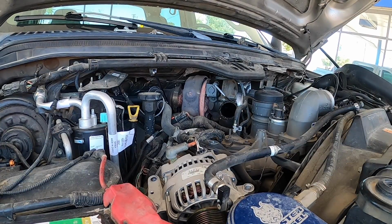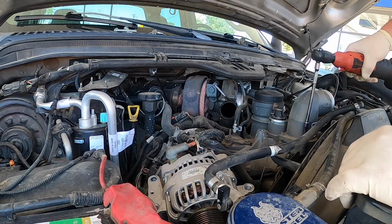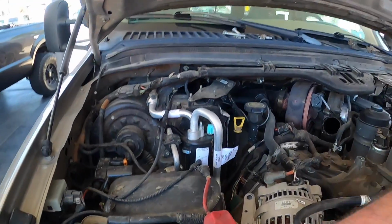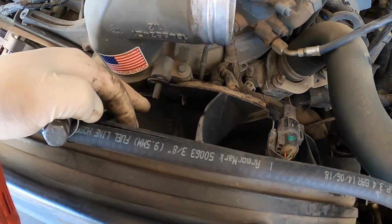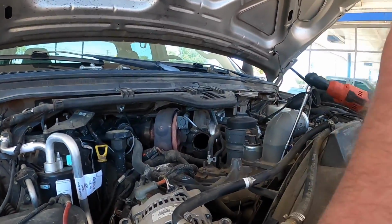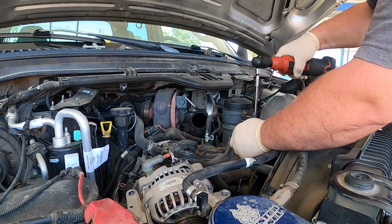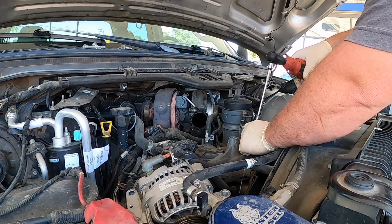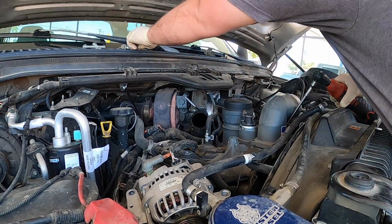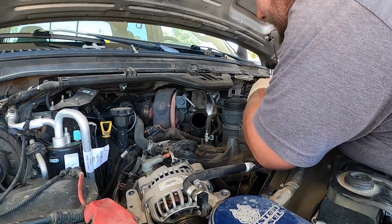Okay, next on the chopping block, we're going to pull the 8s out of the intake horn into the intake. You have to take this off because there's a tab that goes into the fan stator, and most people don't understand this tab right here. This is just an alignment tab, so when you put the stator in, it stays there because it's kind of heavy to hold the fan and the stator in. No nut belongs there. All it is is a stud and a hole. Had some people put nuts on them. I mean, I guess.